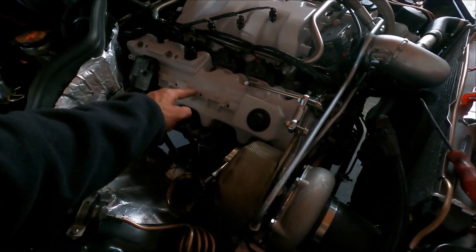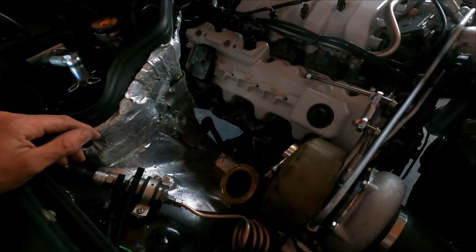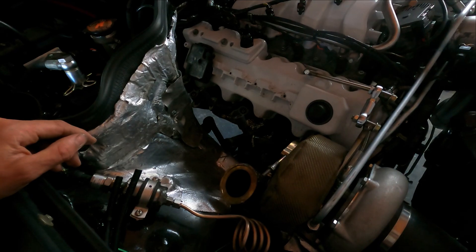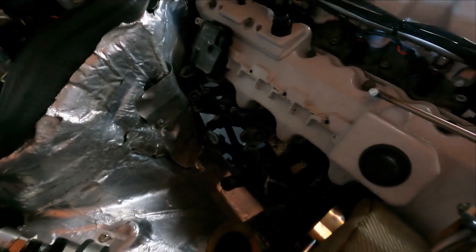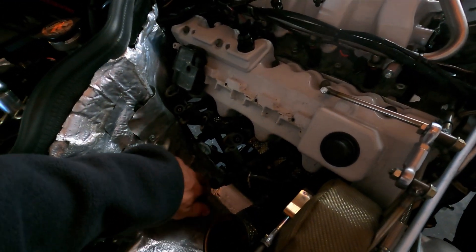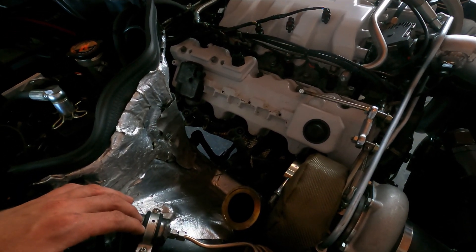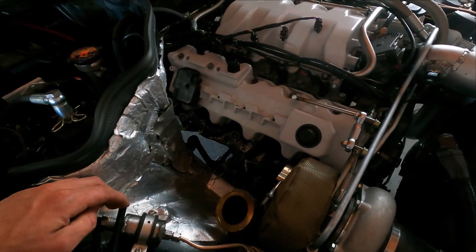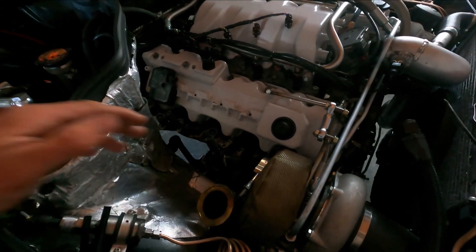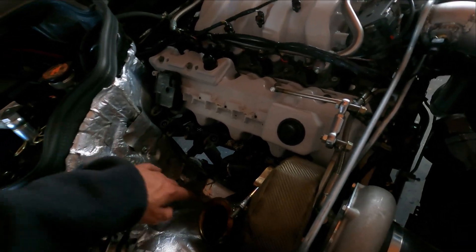I also had to remove three coils - I have to turn it and then pull it out, so it's pretty tight. That also makes sense why I could not fit the bigger downpipe. I cannot fit a four inch or three and a half inch in here. If I want to do that, I have to modify this section here to get a bigger downpipe in. If I want to in the future - if I've got too much back pressure in the exhaust - then big modifications are needed and the engine needs to come out to modify this section to get a bigger pipe in there.